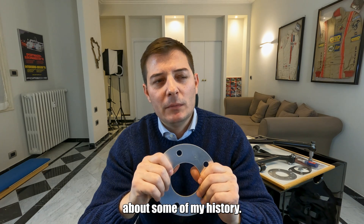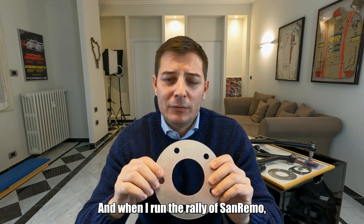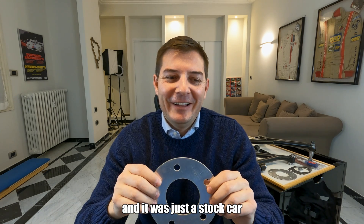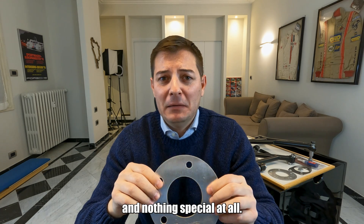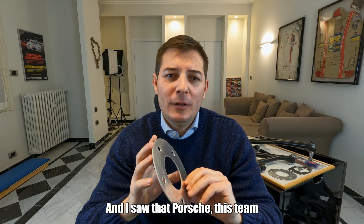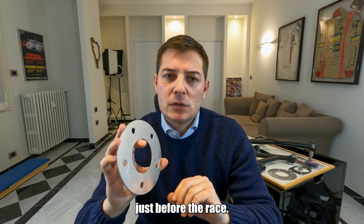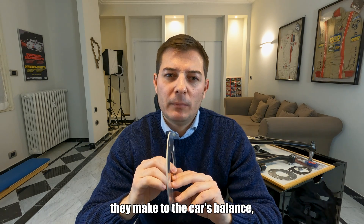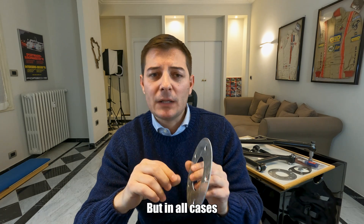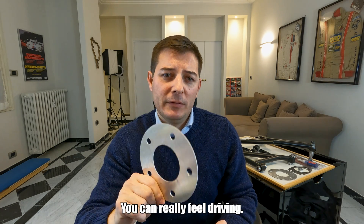Let me talk to you about some of my history. I have had some big, good moments racing with Porsche Caymans and rally Porsche Caymans. When I ran the Rally of Sanremo, I drove this car for the first time — it was just a stock car that came from a single brand trophy on track with Bilstein PSS10, nothing special at all. I saw that the Porsche team had all these shims in the front, and I used them to test the car just before the race. In that occasion, I got the exact feeling of the difference they make to the car's balance, especially with a mid-engine car. But in all cases it makes a big difference, and I can tell you that shims of two millimeters like these ones you can really feel when driving.